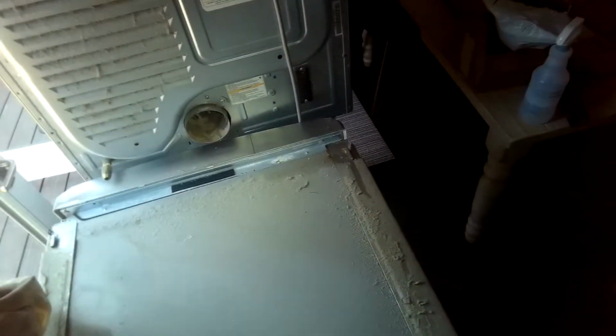So other things that can cause a leak are a dirty glass bowl, the door boot of the washer. If you clean the bottom aspect, a lot of times that'll get rid of the leak. Sometimes the door boot has a small hole in it, but if those have been checked and you still have a leak, it could be this thing, which is the fill valve, and in particular the hot side fill valve, which is what's going on with this machine. So we're just going to be replacing that, which is pretty easy to do.